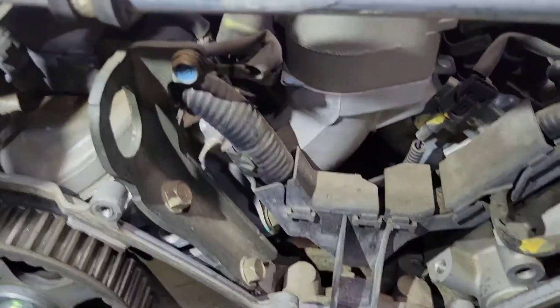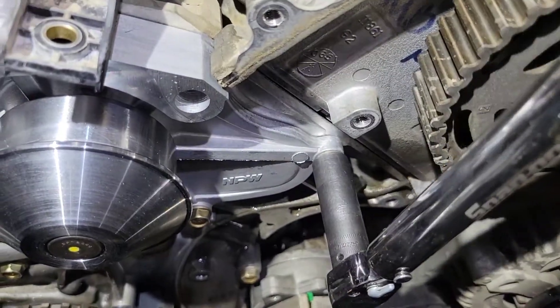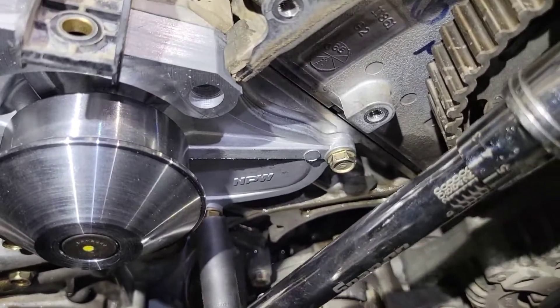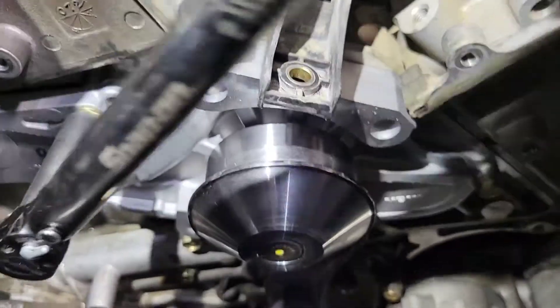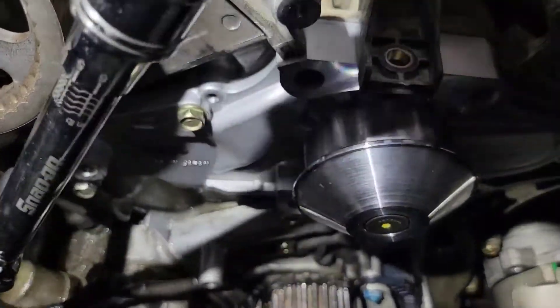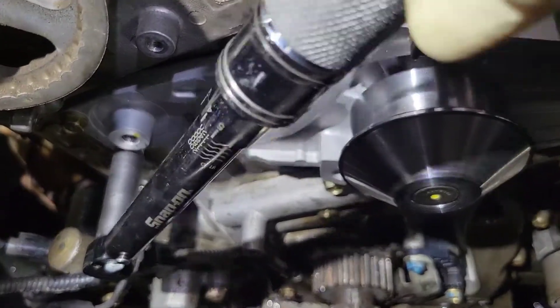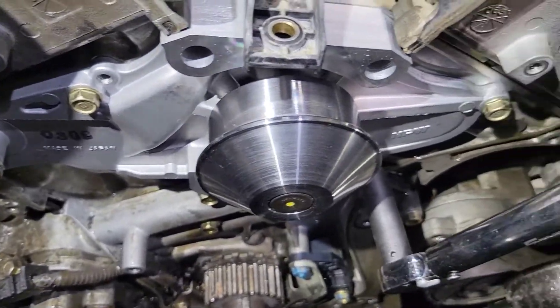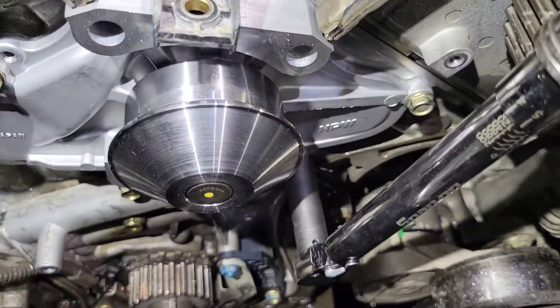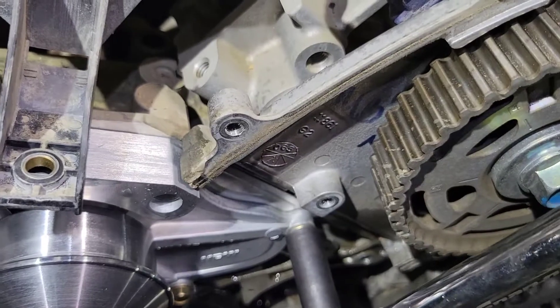You've got your water pump up with five bolts. Torque those to 106 inch pounds. It's very important that your torque wrench is working properly — on the tool trucks they have a calibration checker. I had a Napa inch-pound torque wrench that wasn't torquing properly on the lower torque scale. I would torque plastic intakes and it just didn't feel right, and when I checked it, it was way off. Now I have a Snap-on inch-pound torque wrench. Make sure your torque wrench is of good quality.